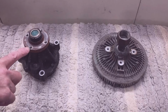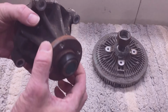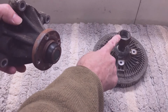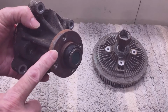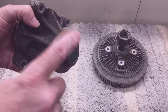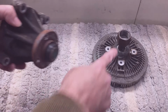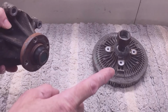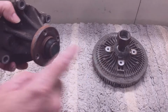The second problem is actually holding the water pump shaft from turning while you turn the hex nut off. And there are some tools that use a pneumatic air chisel to impact, and you don't have to hold the shaft, it just impacts that nut off. Let me see if I can find one on the internet and I'll show you. I'll put an insert in here to show you.